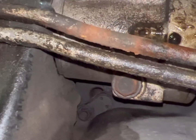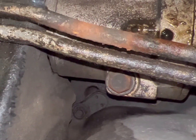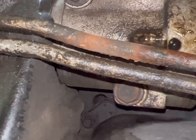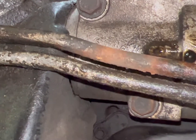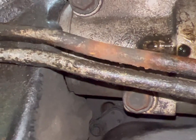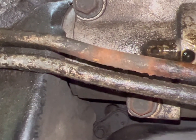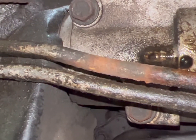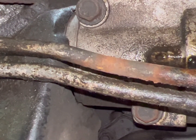The other thing is you want to check and make sure that these two bolts are GM bolts — or ARP in some cases, as people do replace them. If they're not, you're going to find yourself wanting to purchase a pair of starter bolts; otherwise you could risk breaking them off in the block. I check the tightness on mine basically every 15,000 miles or less, and I'm actually going to do that today.